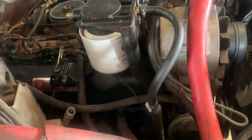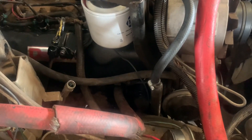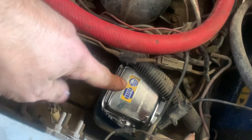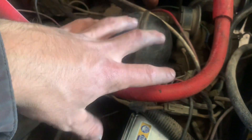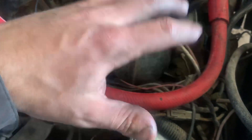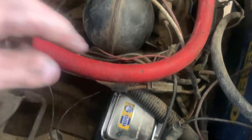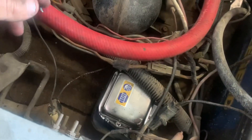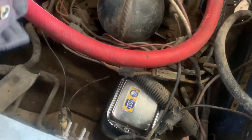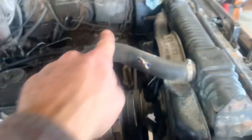That's how I did this. I'm posting this more for myself than for anybody else, so I can remember how to do this when I inevitably buy another one of these. On a new voltage regulator - make sure the grounds on these are good. If your headlights are flashing at idle and then vary as you speed up, it's because they don't have a good ground. Clean the ground up and generally they'll be fine.